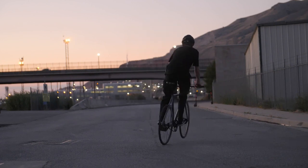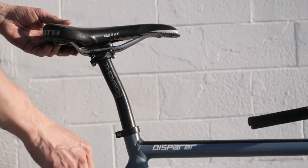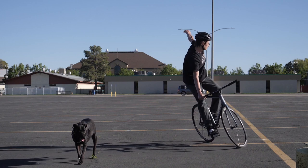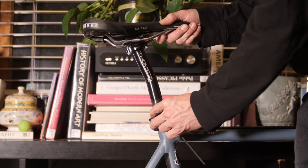The last and definitely not least important tip is adjusting your saddle height. If you've watched any of the trick tutorials on this channel, you know I talk about this one all the time. Fixed gears are big, goofy bikes and you need to be able to move around and adjust your balance, which is really hard when your saddle is all the way up at the proper riding position. A lot of people don't actually know their proper saddle height — I'll link to one of my favorite calculators in the description as a starting point. For aerial tricks like bunny hops and 180s, especially when first learning, put that seat as low as it can go since you're not using it for anything. Tricks like wheelies and keos require you to put body weight into your saddle, so keep it at a relatively comfortable riding position — though I still like to drop it half a quarter of an inch just to get a little extra room to move around.